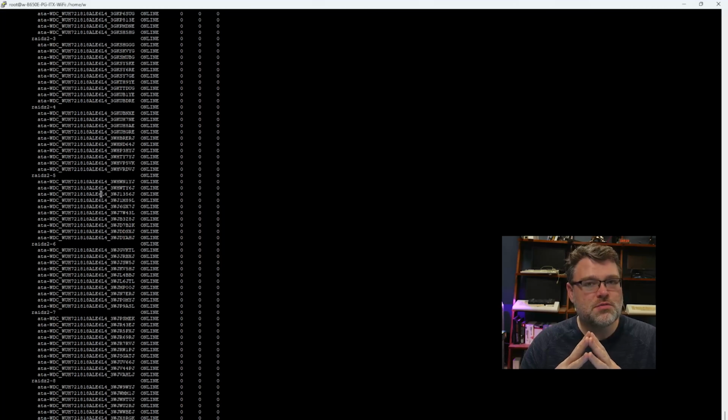but I'm also thinking about a couple of specific DRAID configurations. And maybe we could throw in a striped mirror just for fun. It's only 45 drives of capacity, but that's sort of the maximum speed. And then any one disk can fail. And chances are, if a second disk failed, it wouldn't be fatal. But there's a small chance, just a few percentage points, that it would be fatal if a second disk died. And then maybe some RAID Z3 configurations just to see how that works.